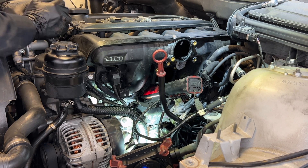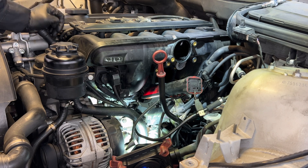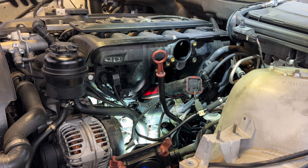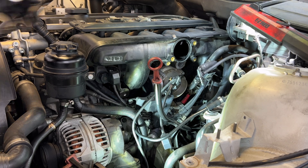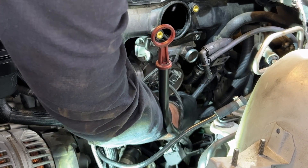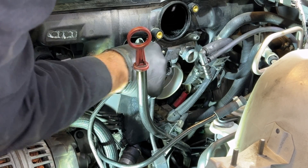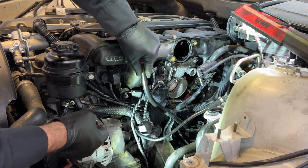Now for the top. If you want, you can put some lube on these things — you can spray some silicone spray, that's actually the best. You can use Vaseline of course. So everything on the valve is all back together — all the pipes. Now we just put everything back together. We start with the throttle body and the idle air valve. Now we're going to do this connection unit. At the bottom here is a little tricky — there's a stud coming out of the throttle body. Don't forget to put the nut on that. Also the 13 millimeter nut for the dipstick tube. Now the DISA valve.